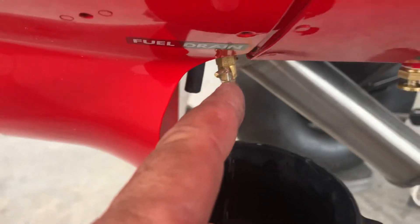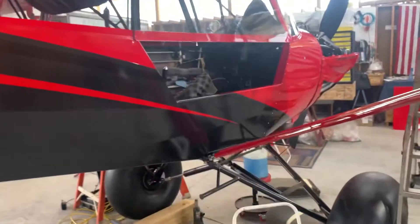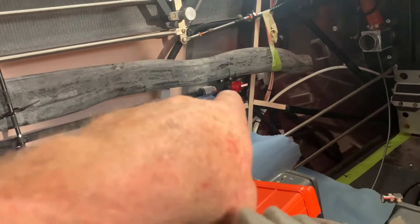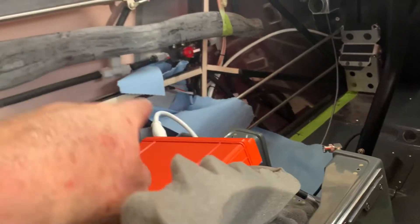You can lock this up, as I've done here. You should have fuel here and fuel out of your back drain, even with the selector in the off position. What I've also done is take blue paper towels and stick them underneath the fuel selector — underneath all the fittings right here. I don't put my interior panels in until all this is done with my fuel.